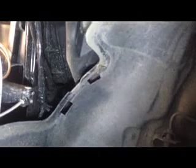What I have to figure out in here is where I'm going to tuck in the ballast. I think I'm going to take that corner over there and zip tie it to that back corner. So I'll update you in a minute. Overall, the connections took about 5 minutes. When I first turned on the headlight, it didn't come on. So I went into this connector and just reversed the lights and it came right on. So, all right, good deal.